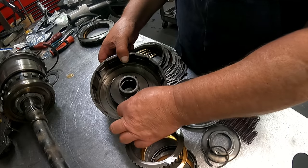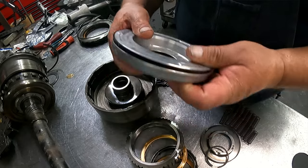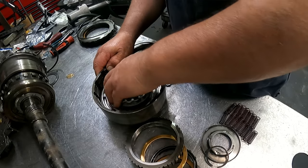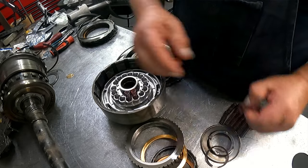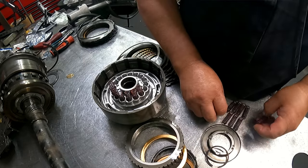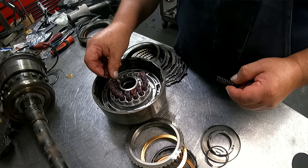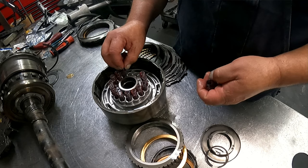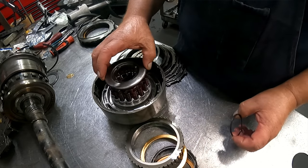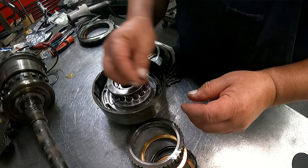All right, direct drum. I have a lip seal in here. The lip faces up towards you. Lip seal's here. The lips face up towards you. Make sure this ball is rattling around inside there. All right, our springs are loose on this. We have the retainer that holds those in. Short end of the taper is going to be up on our snap ring.